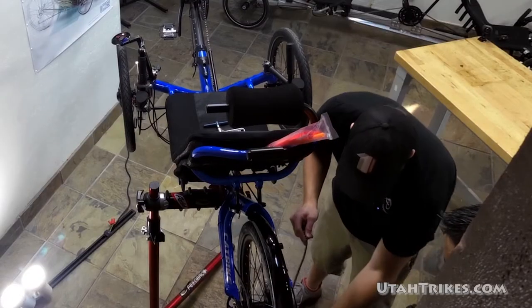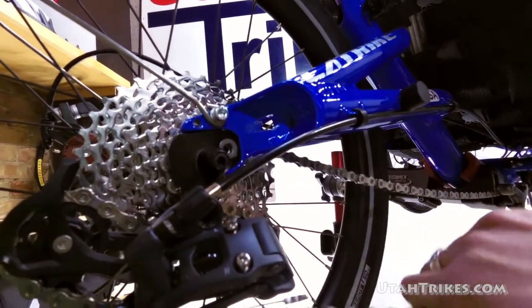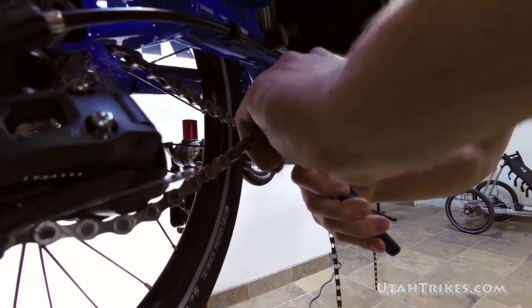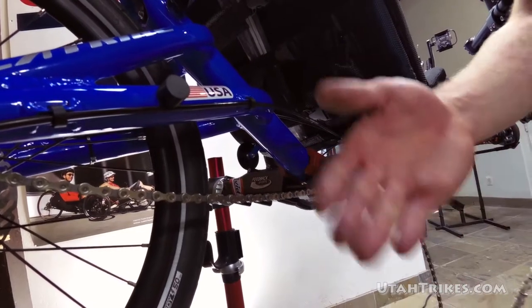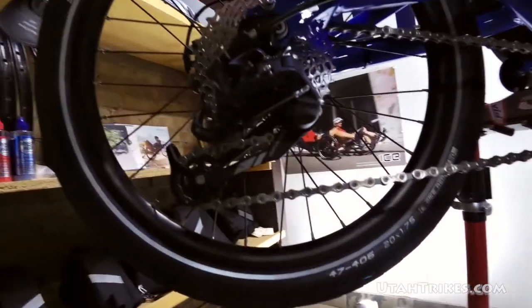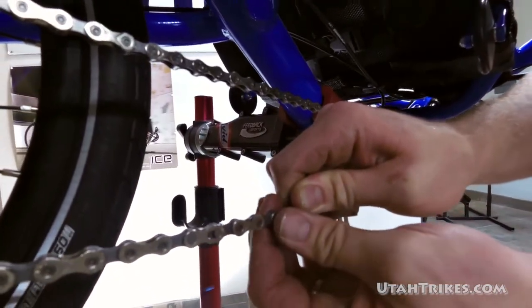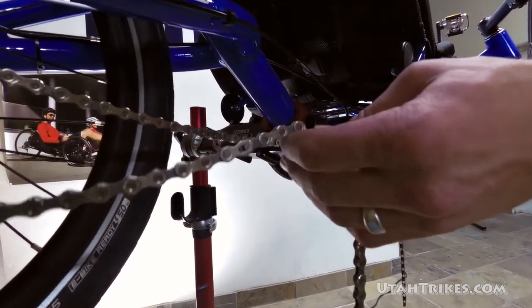To start off with, we'll take our additional chain — we're going to be slicing in here. I've got way more than we need but we can work with it. Now that we have our extra length added in here, again just using one of those master links, we're going to grab each end of the chain — just like last time — and pull the derailleur into a position that we like. That's going to give us adequate clearance on the derailleur and allow us to use all gear combinations possible. We'll go ahead and cut this link out.